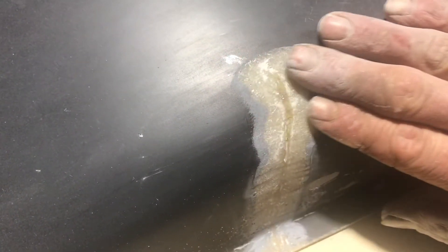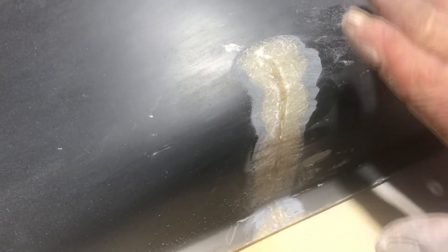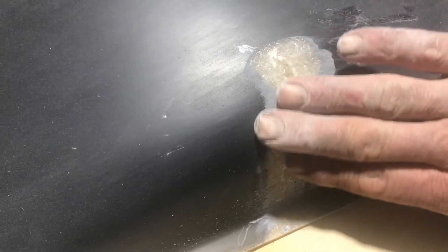If you were just going to do body filler, then you must get to the bottom of the crack where there are absolutely no sharp joints. Because we're going to glass over the top of it, we actually don't need to go right down to the very bottom because the glass on top is going to hold it all together. But you don't want to be relying on body filler to hold things together. I want to make sure I get a nice deep groove in there so we can get a good 1mm of glass in there. We've got a 1mm strip behind it — we want a 1mm strip on top as well.